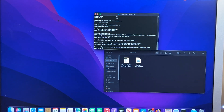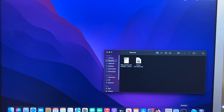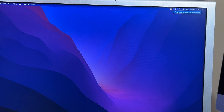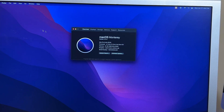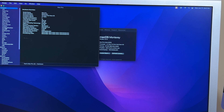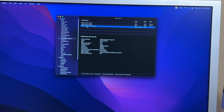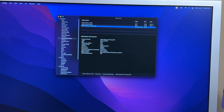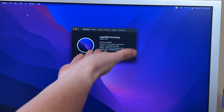It's been a while since I've done this, so let's find out if it works. We'll close out Terminal and restart the system. It does show up in the corner of the screen — that's a good sign. Going to About This Mac, then System Information, then Displays — there it is, it's working. So we unplug the Mac Pro from the monitor and plug it directly into the eGPU box, and going back to the Vega 56 — it worked.